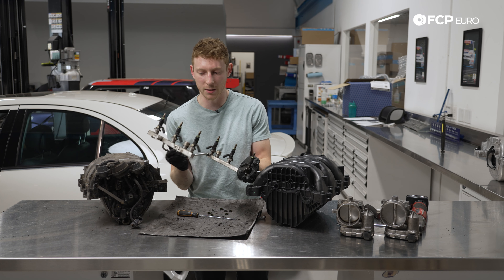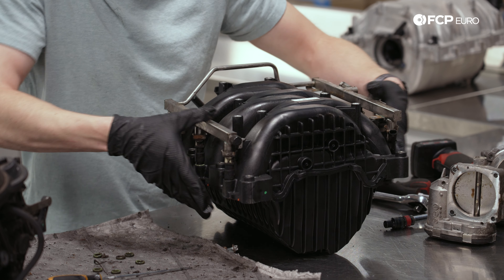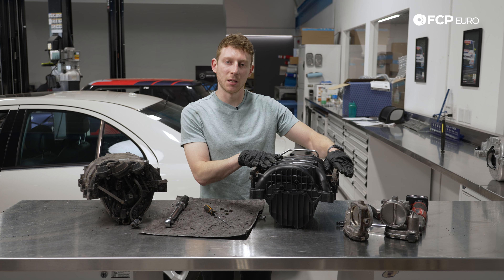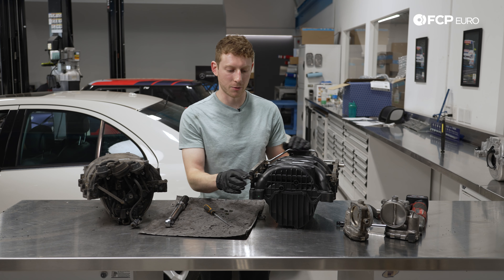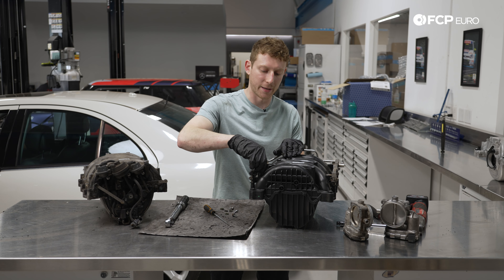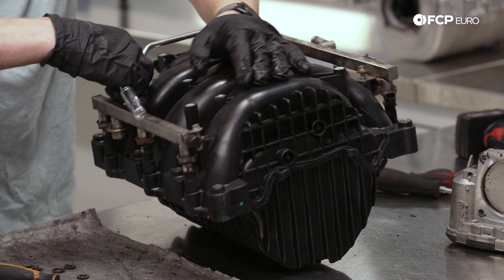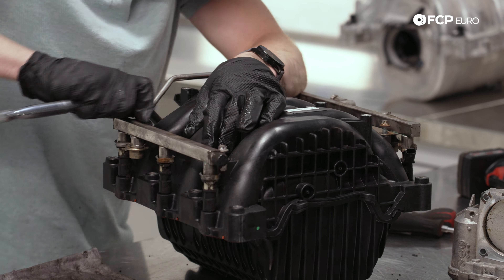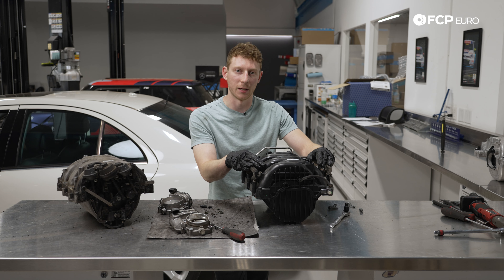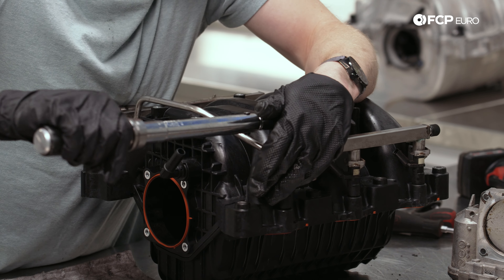We have swapped on our new injector seals from the intake manifold kit. The seals are on and lubricated. We're now going to slot this onto our M014 manifold, gently get these seated, and push them in — you'll hear them clunk down. With the fuel rail seated, we take the four bolts from the original manifold and bolt the rail back down. Note that none of the inserts on top of the intake manifold are threaded — that is intentional. The bolts tap as they go, or you can manually tap them. Torque the four fuel rail bolts to 9 Newton meters.